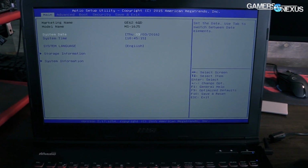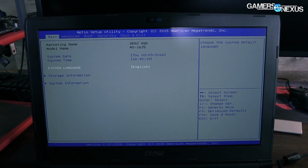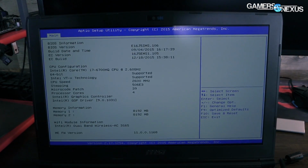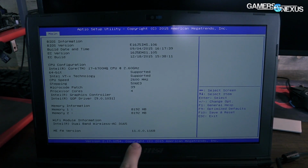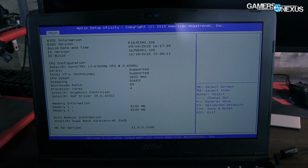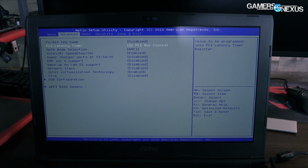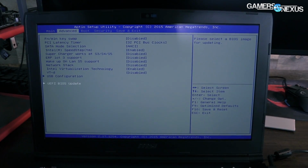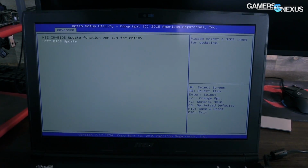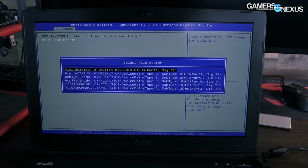There also were issues with the embedded controller firmware and BIOS, which had the fans operating at low speeds that allowed massive heat accumulation. We had the CPU running at 41C delta T over ambient idle, which is about 61 Celsius absolute in our environment. That is completely unacceptable, and the surface of the laptop, the part that you actually touch with your wrist, is about 105 Fahrenheit under these conditions. Definitely uncomfortable as a user.